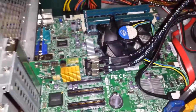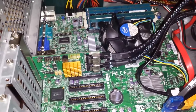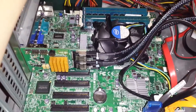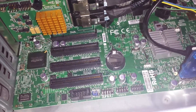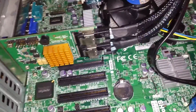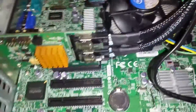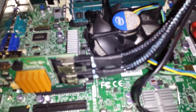Another thing with this motherboard: you want to make sure the power supply is EPS 12V compliant, basically it has two CPU power connectors and needs to supply sufficient power to those. This is actually a really low power supply — it's 380 watts — but it seems to run fine with this number of drives and a low power CPU. Also, this motherboard is weird with the CPU fan: it doesn't have a dedicated CPU fan header, it just has five fan headers. I put it on fan header A since the rest were labeled one through four. It seems to work, though I hope it's actually regulating the speed.